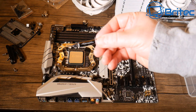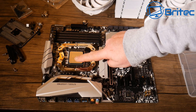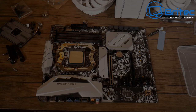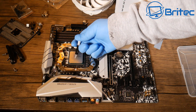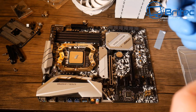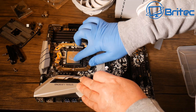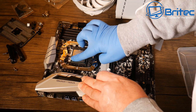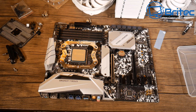This particular compound is very thick — like toffee. Putting a blob in the center and trying to spread it with a glove shows the problem: it dries up and starts rolling off rather than spreading. So you can't use the spread method with every compound. Arctic Silver spreads really easily; thicker compounds like this one are better applied with a card.